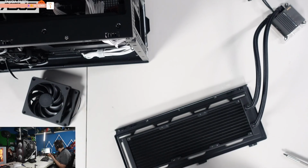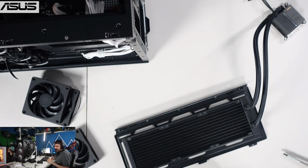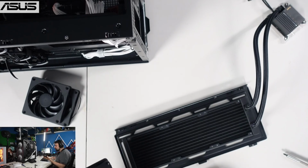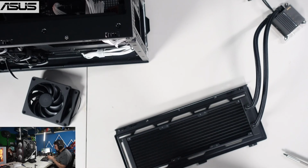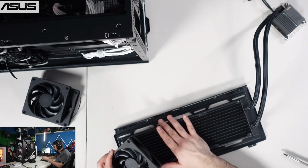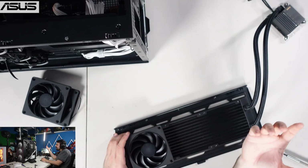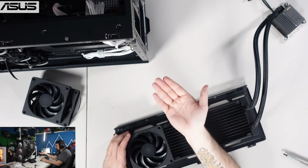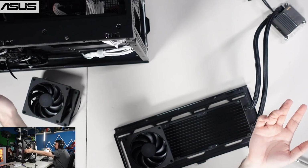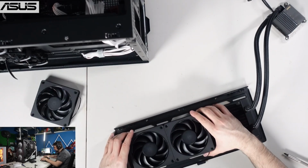Now what's really nice is these fans are daisy chainable, which is so nice. Now, we want this to be an exhaust. Because this is going on the top of the case, we want it to be an exhaust. Our intake is going to be the front of the case, and the power supply is going to do it itself, but the intake is going to be all through the front and then exhausting through the top and the back. Oh, look at that. See? Oh, that's so cool.